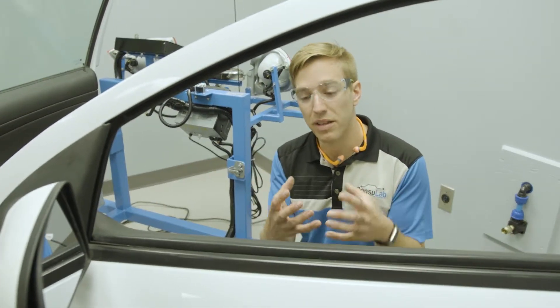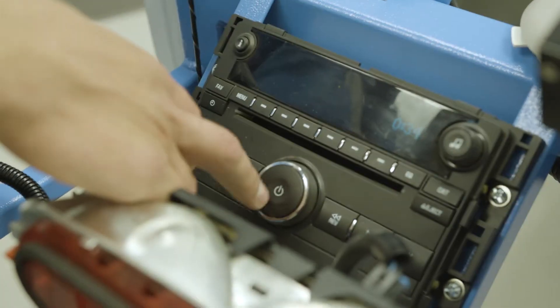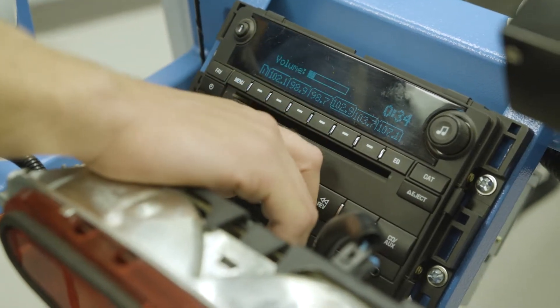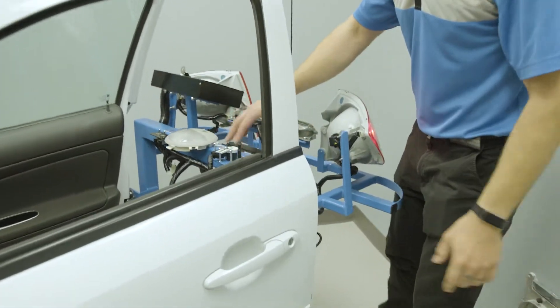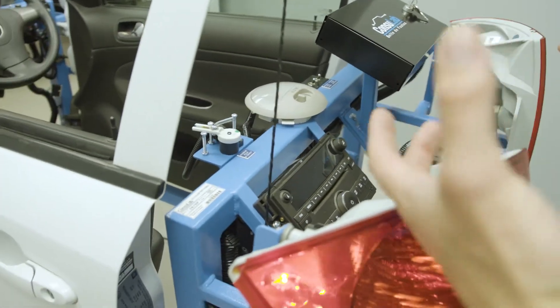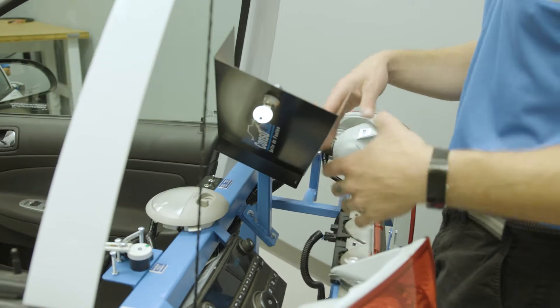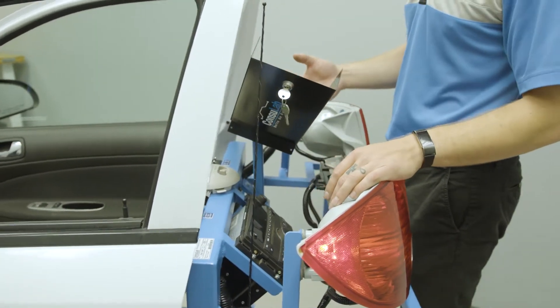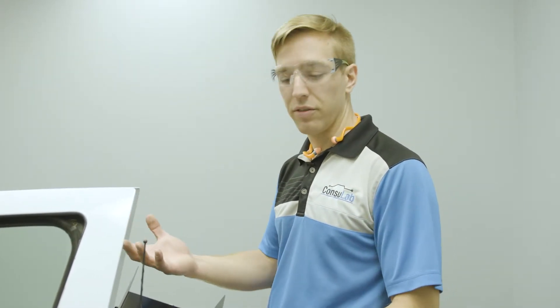We have that repeatability that makes it easier for your students to do it over and over again. We have the radio, the brake switch, and all of the different components for the entire system. We add to that a fault box where we can insert various different faults and the students can go through and do diagnosis of those faults using real-world diagnostic charts and using the scan tool.